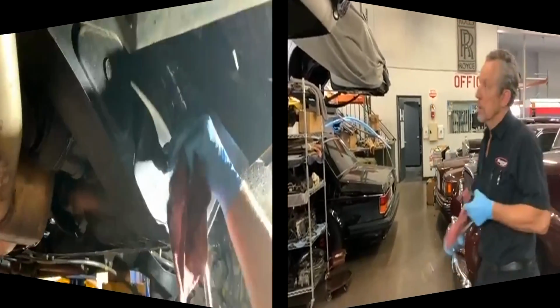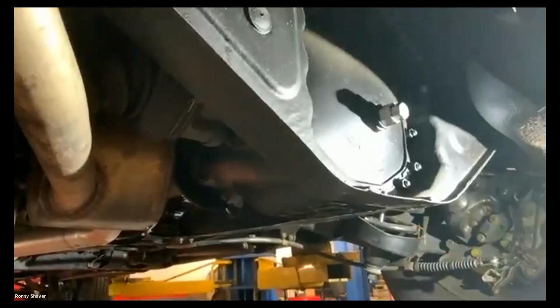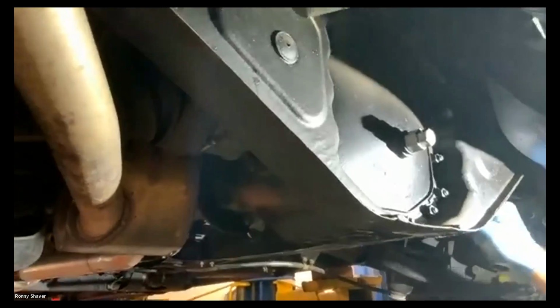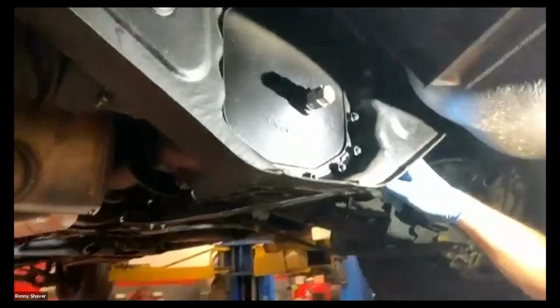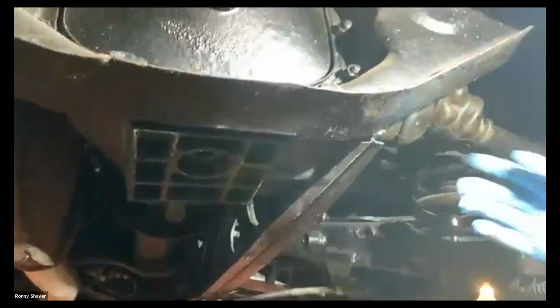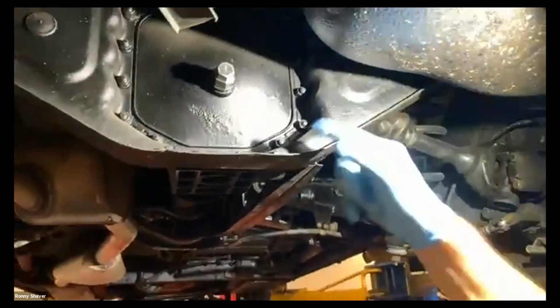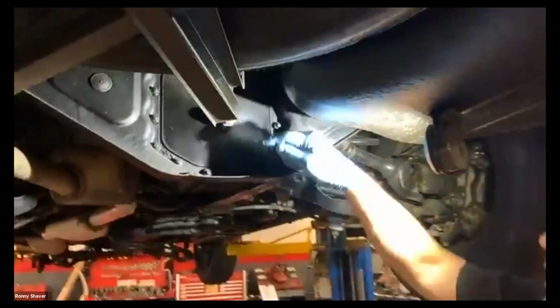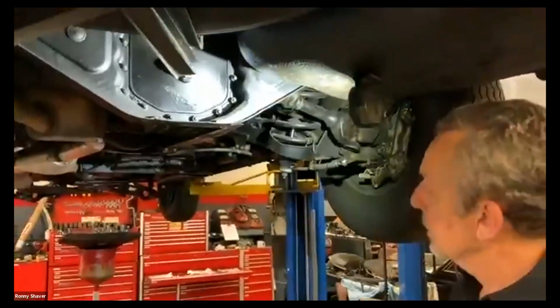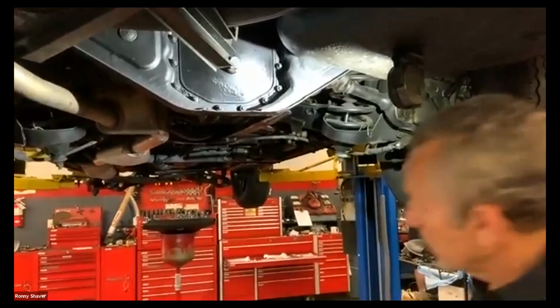Same with this. This is the tool. Now I'm going to wait on this only because the Silver Shadow in the back has these axles that are supposed to have oil in them. And during the service, we're going to top these off. But what happens is that oil doesn't leak out, but it'll push into the differential. So almost every Silver Shadow that you pull this off to check the level, it's only supposed to come up to there. As soon as it stops dripping up there, I'm going to do it right now, actually.